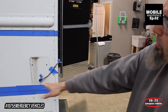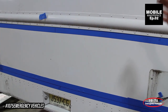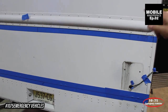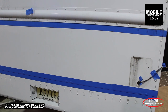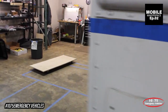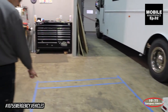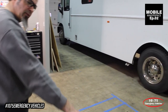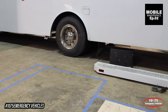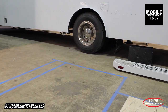What we're doing here is plotting out and measuring for a hydraulic liftgate. Once we cut in a rear manned door, the hydraulic liftgate will allow access to equipment that can then be wheeled out onto the liftgate and down onto the ground. We're simulating the width of the door opening and the maximum size of the cart that will be wheeled out onto the liftgate platform, making sure it will roll out safely so it can be lowered onto the ground.